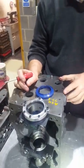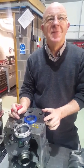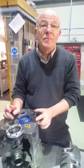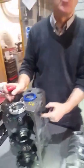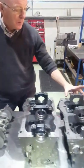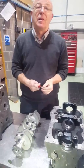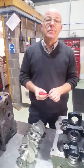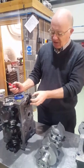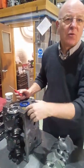If you're going to the extent of fitting this kind of modification, you're probably going to need some engineering knowledge. Can you convert an A-plus mini engine to an inline? You could, but you'd have a different distributor. If you're happy with an A-plus block, the same things apply — you've got to drill and tap, put the extra holes in, drill and dowel the face. It is possible to use an A-plus block, so if you're building something like a hill climb midget where originality isn't that important, you can go for it. You can obviously use the marina block, but the downside is the oil filter is right there, and when you change oil filters oil drips down all over the engine, chassis, and floor — it's a mess.